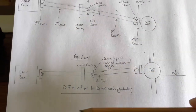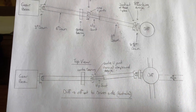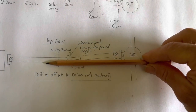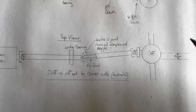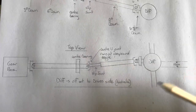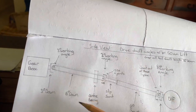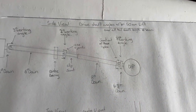I also realised the centre U-joint and differential U-joint run at a compound angle. Looking from the top, the differential is offset to the driver's side by about 15 millimetres off centre here in Australia. That means this U-joint is running at a compound angle. There's a formula to work this out — it requires running string lines and it's quite a hard thing to do. But it added about 0.5 to 0.7 of a degree more working angle, so roughly 2.7 to 3 degrees compound overall — bringing the effective working angle up to around 4 to 4.5 degrees.